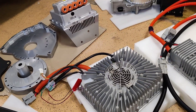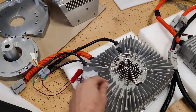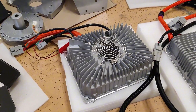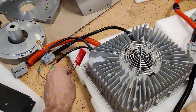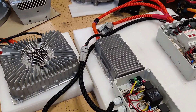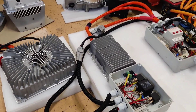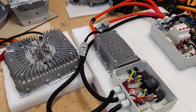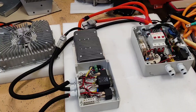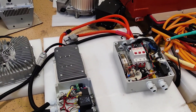This is the 3 kilowatt charger with custom electronics designed to activate the charger when connected to the grid. This is the CAN bus module that automatically activates the charger when connected to power. There is also a Type 2 socket with a push button to activate charging at a charging station — so you can charge at a station or at home. Our Type 2 socket is custom designed with electronics to communicate with public chargers, so you can charge at any public location, paid or otherwise.